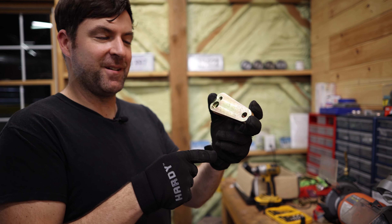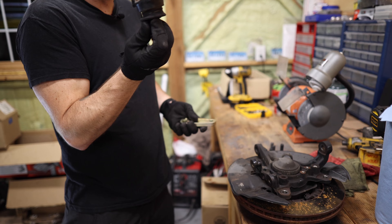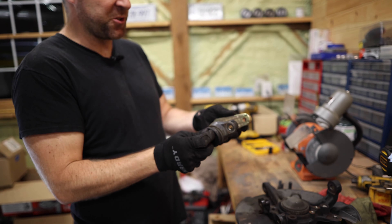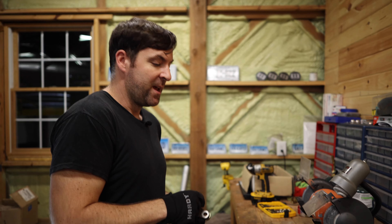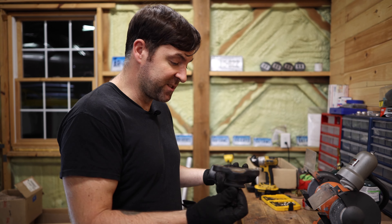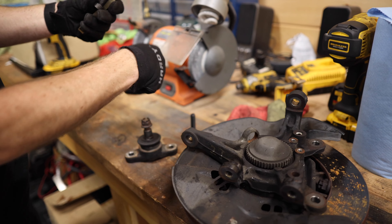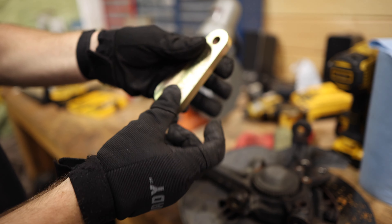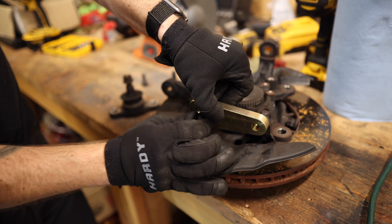Now we're just going to show a little bit more detail on the camber kit from Belayed Motorsports. I think this is brilliant because it actually does two things: it does increase the negative camber by moving the OEM ball joint — you don't have to get an offset ball joint for this. You can use the OEM ball joint. It just moves it out, which effectively adds negative camber by moving the knuckle out. It also corrects the steering geometry — the roll center gets corrected with this just being spaced out for a lower car.